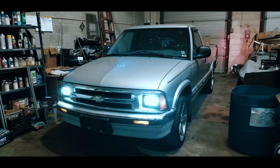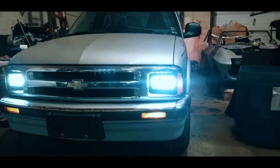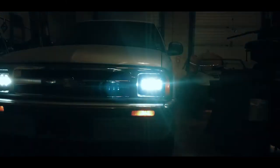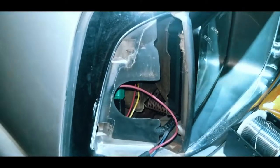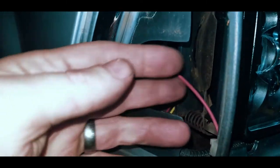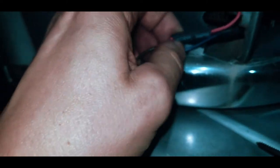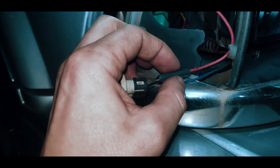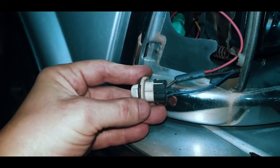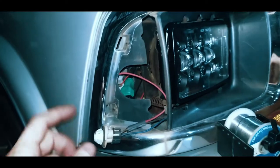Wow, I like that — not bad. So that's high beams. They have a cutoff line — if you get down below the cutoff line it's super bright but above it the glare is not bad. I decided to hook up the side lights. I've got the wire harness right there, just a normal crimp connection around a piece of extra wire and I soldered it in-line. I used marine grade heat shrink — highly recommended — this will keep this part from getting any water. If you want your lights to come on with your corner markers on the first switch position, wire it to the brown wire.